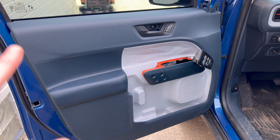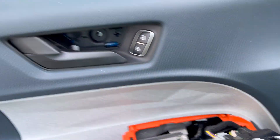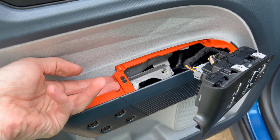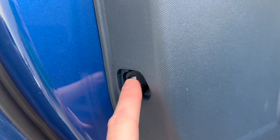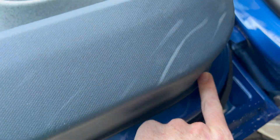So to get the door panel off on the 2024 Ford Maverick, there's one screw here with a little plate that covers it — you have to pry the plate off and get the screw. The window switches have to come out; you pull them up from the back and forward, and there are two bolts under there. You have a little cover here — mine was red, like a little light thing — pop that out and you have one screw under there, one here, and one up here.